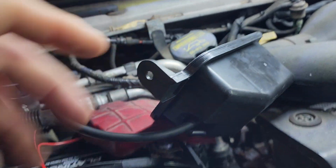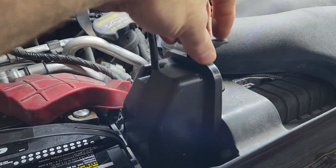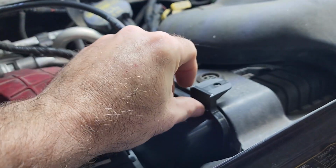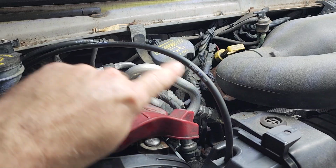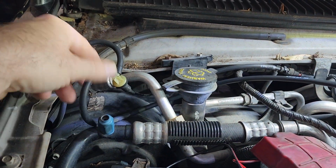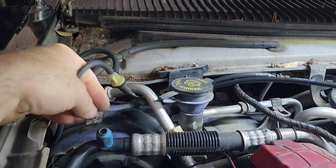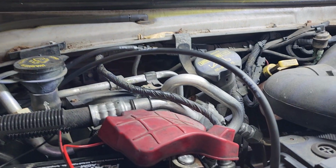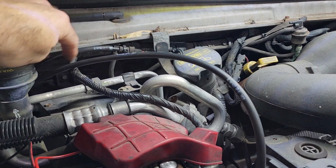No AC for you. So what I'm going to end up doing, this will get relocated because it fits beautifully right here. All I'm going to do is drill a hole and put a spacer with a screw. Ta-da! Now, I've run a new line here that's going to go right into our original splitter with our line that goes down underneath the glove box that replaces the old line, and I'm tied into our factory line over here that actually comes straight from the engine vacuum supply.